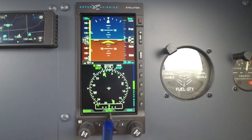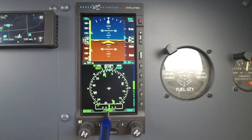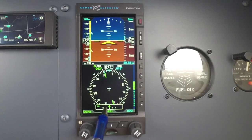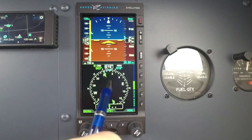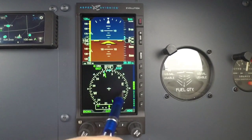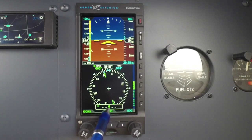If you come across the middle here, I've got GPS-1, and you have two inputs — GPS and NAV. So we have GPS-1 here, and right above that you'll see my CDI needle. Here's my CDI needle, and here's my course needle. So you get course needle, you have a slave compass, and then your CDI needle at the bottom.